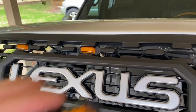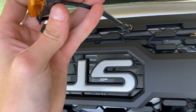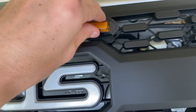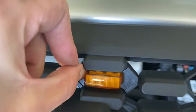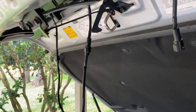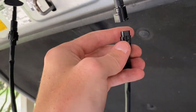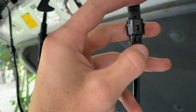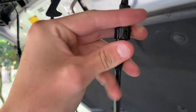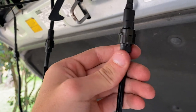To show you how to put these amber lights in the grille, it's pretty simple — I've already done two of them. You just take the light, slide the wiring part through any one of these full hexagon shapes, push down, and it snaps in just like that. The harness just slides right into the light — push it in and there's a tiny little click, and it's good to go.